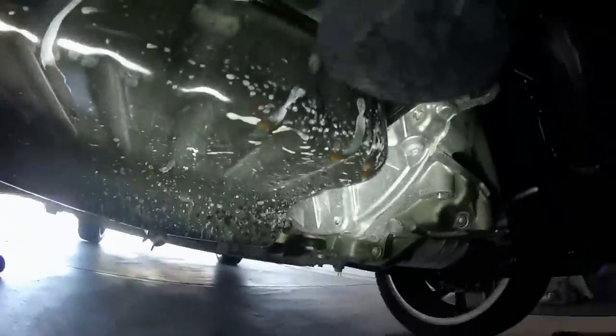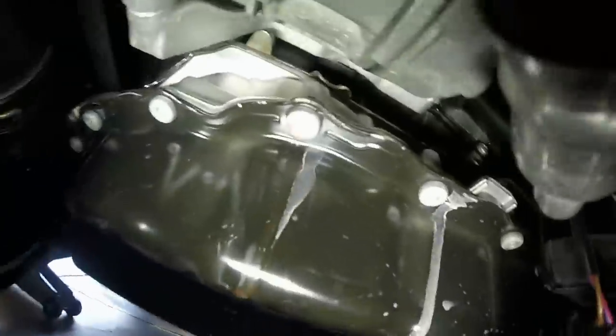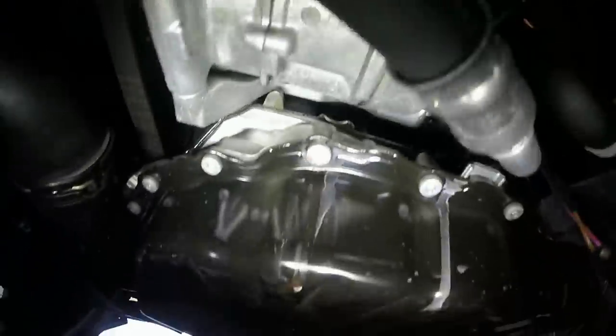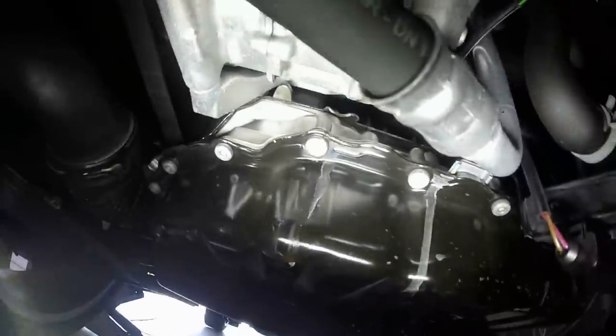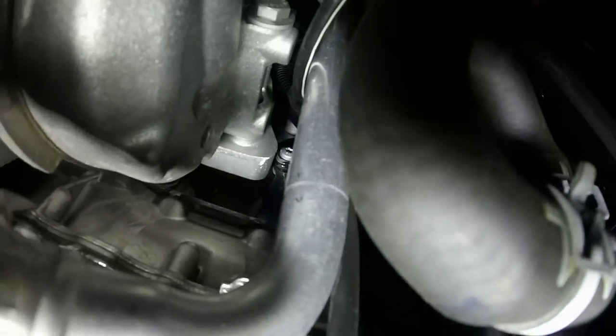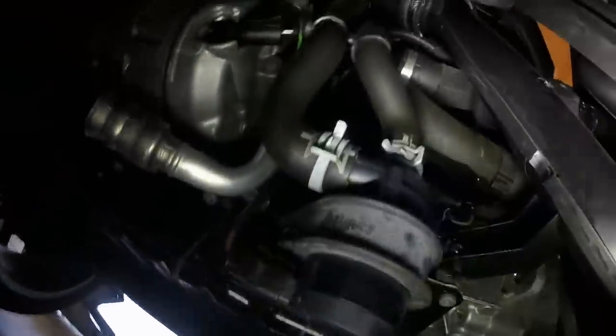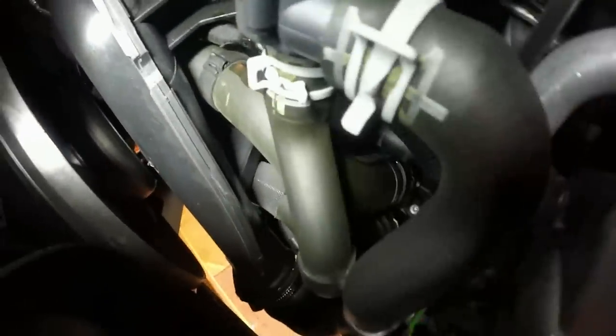Okay, coming from right there — the oil pan area. It's not the radiator; it is the water pump. You can see up on the block — little white stains on all kinds of stuff up there. I gotta get this to the dealer real quick and pray it doesn't go out on me. You can see it's coming right down that radiator hose, dripping right there.